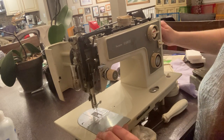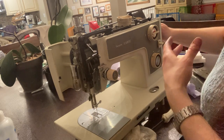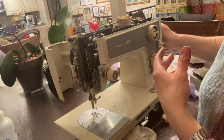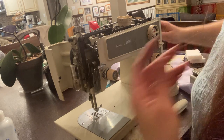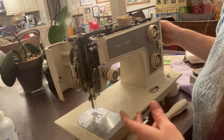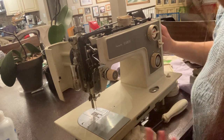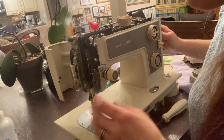A little more oil and she's starting to move really good. Once you get her to a position where you're not forcing it so much and it's an easier movement, you'll be able to use the motor to get her going. You're gonna need to run her and add oil, then run her for about three minutes, then add oil again, and keep doing that to really warm up the whole mechanism.